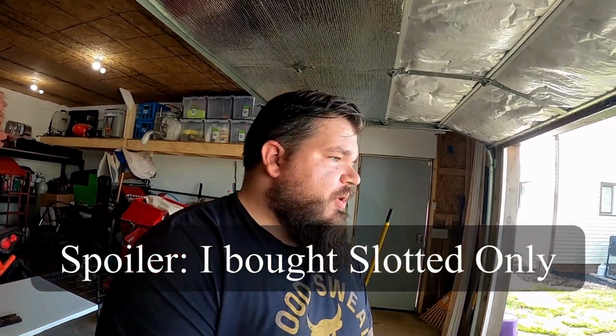So for this truck here, since I do some more towing with it, I don't quite have the trailer brakes on my trailer figured out. I wanted to make sure that this thing was going to be able to handle anything I threw at it. Obviously, if you're hauling something, your truck should not be your primary source of braking with a heavy load anyways. I get that. So I went with a drilled and slotted rotor from EBC for the fronts to save a little cost. I went ahead and did a solid rotor in the rear. Mainly did the drilled and slotted in the front, or dimpled and slotted, sorry, because they do the majority of your work.